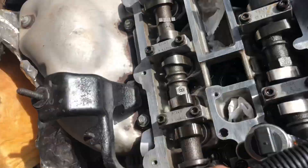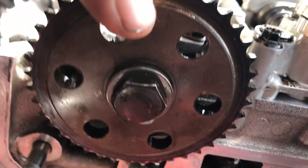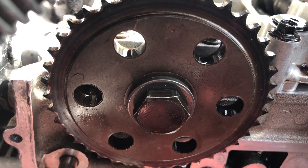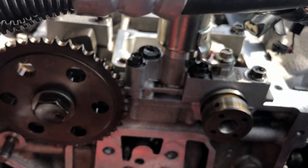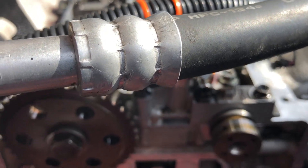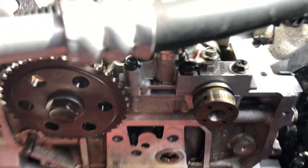The piston is at top dead center. And if you look here, take a look carefully — the cam sprocket has a dot right there. That is supposed to be at the 12 o'clock position. You're supposed to set all this before you install the timing chain. Too many guys are doing it wrong. I'll show you again here in a few minutes what I'm going to do.